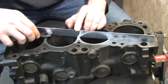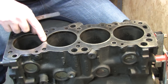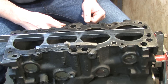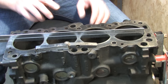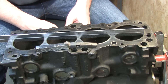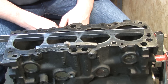Now let's try the diagonals. So there's a little spot right here, right here, and just barely loose there. What it looks like I'd probably have to take off is about a half a thousandth of an inch. Chances are the tolerances for that are going to be within two ten-thousandths, and a quick pass on a mill would take care of this. Now you want to be careful not to cut too much into the surface of the deck because it causes the quench area on the combustion chamber to pinch down and squeeze. Mitsubishi doesn't give you a whole lot of room to work with here. So if you need to take off more than a thousandth, chances are the block is junk. Sometimes people can get away with two thousandths — just be aware that if you do this, you'd actually need to get a thicker head gasket in order to compensate for what's removed.